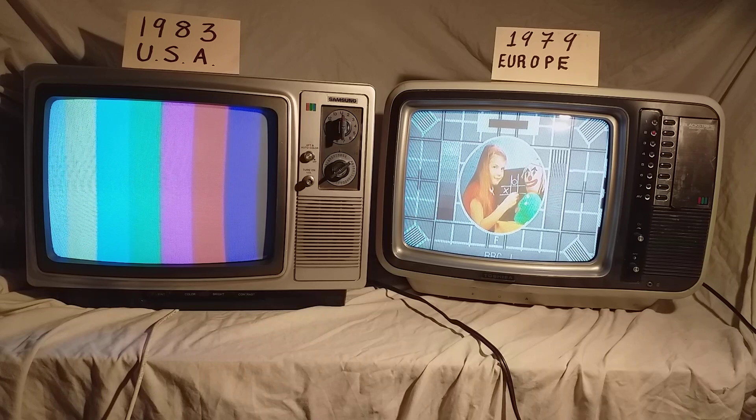The Samsung on the left has mechanical tuners, whereas the Toshiba on the right has a varicap preset tuner. So how come, when you look at older programs from the USA, that older televisions in the 70s, 80s, even early 90s have mechanical tuners, whereas colour televisions in Europe — except for one or two very early ones such as the Baird 700 — always had preset tuners?